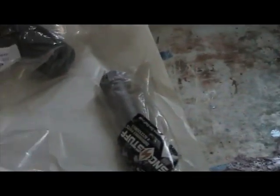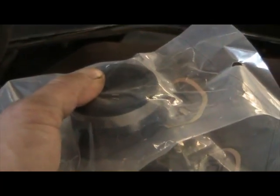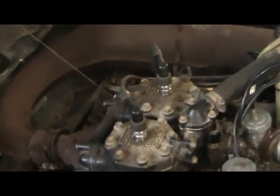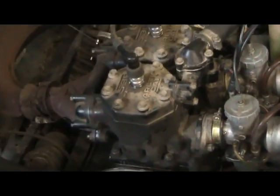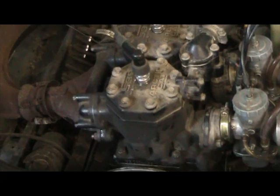So we'll get to work. First things first, we'll go ahead and do the carb boots — those are probably the simplest, most straightforward thing to change — and then we'll move on to the crank seal, which is a little bit more in depth. None of it's terribly hard, and it's actually pretty good maintenance to replace your rubber components on your sleds every once in a while, because rubber has a tendency to rot and fall apart, and you don't want to take a risk of burning up your motor. I knew what the problem was and ran it anyways through the last season.